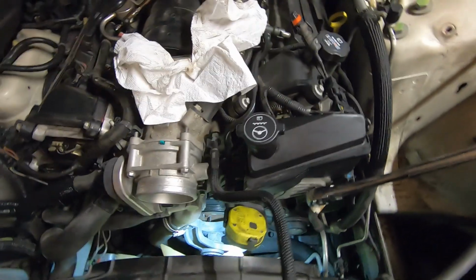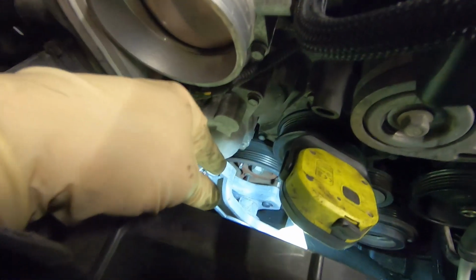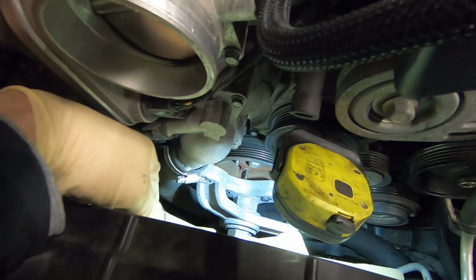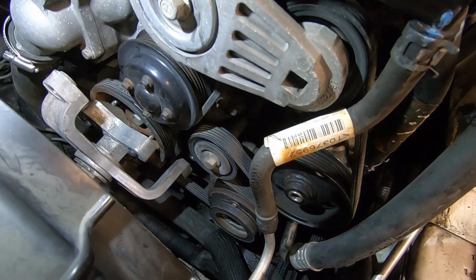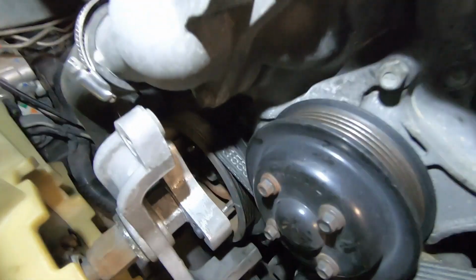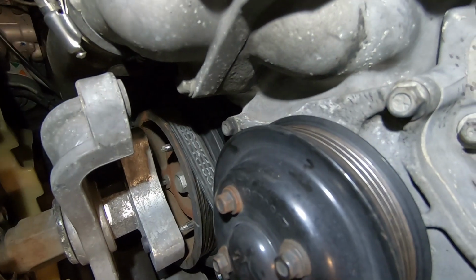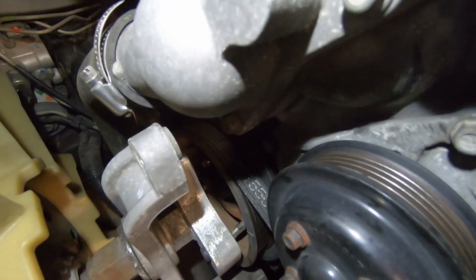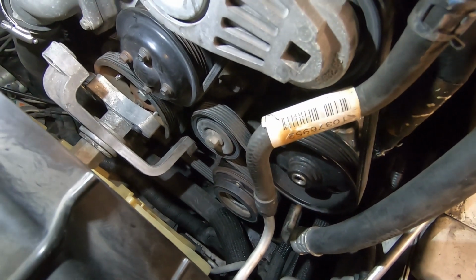That one's looking good. Now we'll move over to this side, and this one takes that double-sided belt. Again, we have to slip it behind the tensioner. We have to slip it behind the pulley assembly here, and then we'll get it routed and get it slipped on. All right, we got that belt all routed on there also. There's actually the part number. Looks like it's 5DPK1550. And I think that's a Gates belt also.